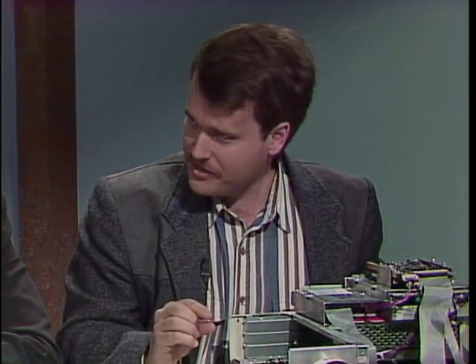The access time is how they measure the speed of the hard drive — it's measured in milliseconds. The smaller the number, the faster you can access it. 12 milliseconds: very fast. 20 milliseconds: not as fast. 28 milliseconds or any number bigger than that, maybe you want to stay away from that, because by today's technology that's kind of slow. The hard drive is the mechanical thing inside your machine that's most likely to break down, isn't it?